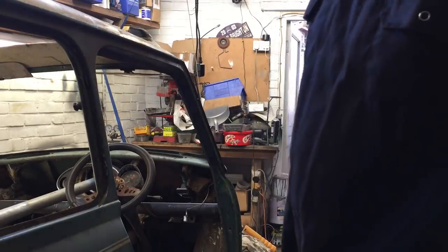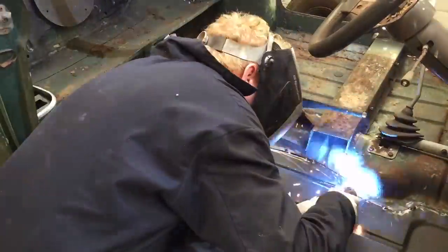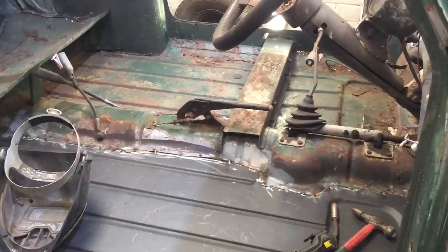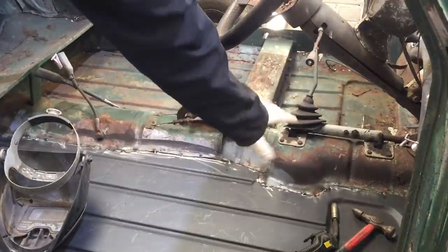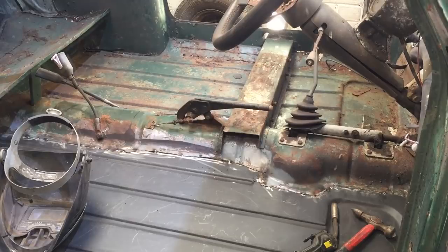Let's get some more welding done on the inside now and try and fill some of these holes up. I've just popped the jack underneath with a bit of an aluminium plate, just on some of the areas where I didn't quite cut it very accurately. So at least now hopefully when I weld, it helps fill up the gap without blowing too many holes. But we shall see.